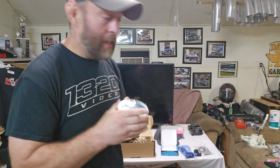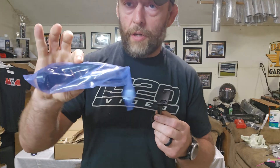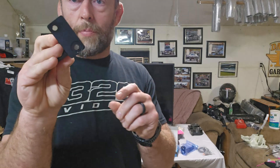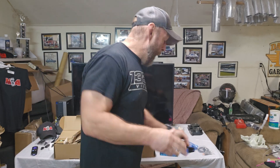I'll tell you how to set it up, but today we're actually going to include a couple of screenshots of settings. They make this thing in two different bracket styles. My personal favorite bolts to where the power steering would be, but every now and then there's a big turbo in the way, so he also makes an under-cam version — this is what the D-series looks like too — which centers up on a bolt that goes to the front cover. I prefer the front-of-head sensor if you're able to run it. It would take a custom top mount with a huge borg-style compressor housing to cause clearance issues, and even then I'll just grind the bolt heads off and use a flush-mounted bolt.